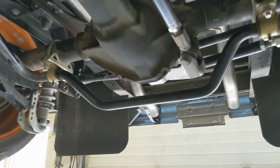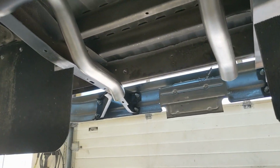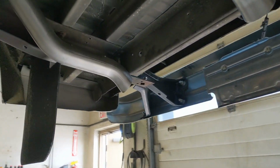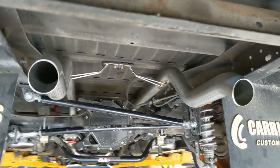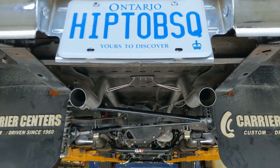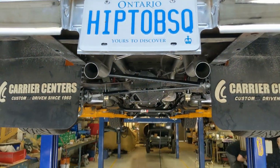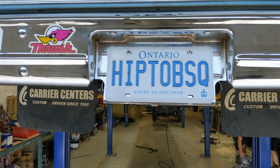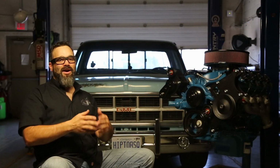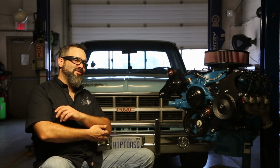We're doing the fueling system along with Edelbrock's ProFlow 4 for the LS. We're going to be feeding that system with dual saddle tanks. So we left the original style tanks in the truck. We went to the '87 fuel tanks that were fuel injected. So we're going to put fuel pumps in the tanks. They deadhead, so what happens is they can't flow back into the tank, so we're going to put a Y block in, put two Corvette filters in line, and then run a Y block ahead of that to fuel the system so we can easily swap between both tanks. Gives us better range and fuel mileage.